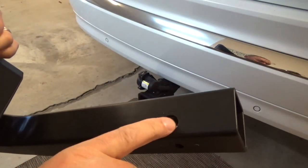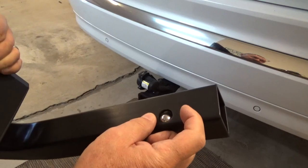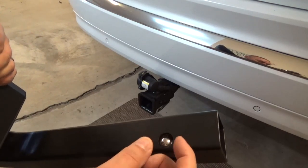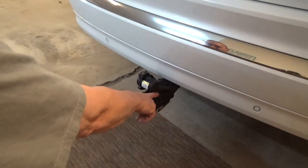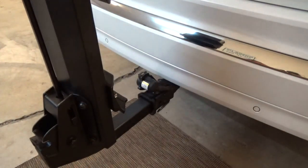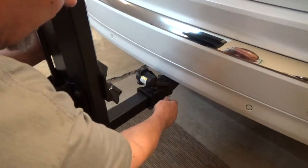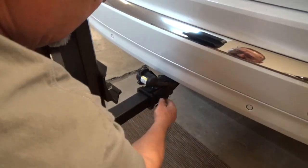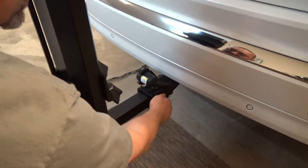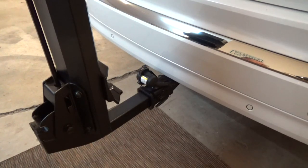The hitch has a ball to keep it from shaking, so it fits firmly. Some brands have a rounded bar about an inch long that fits on the top of the receiver. Inserting it into my vehicle, it stopped right in place — all the way in. Then it screws in, with a lock washer and a flat washer up against the receiver.